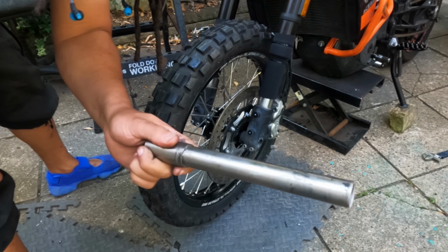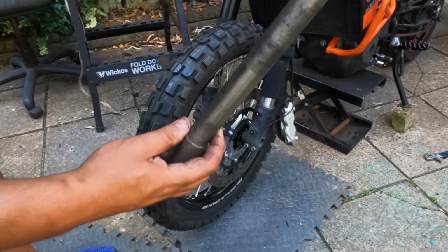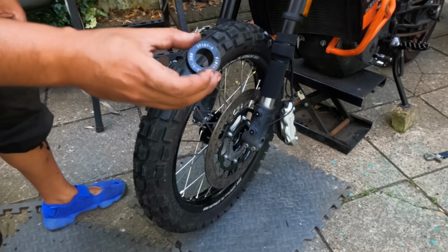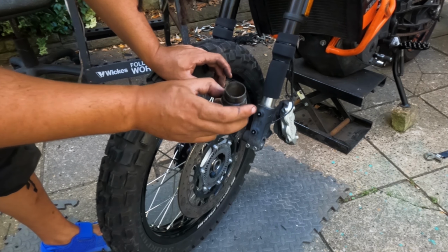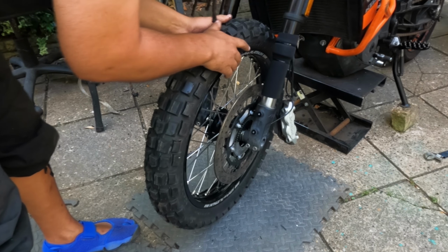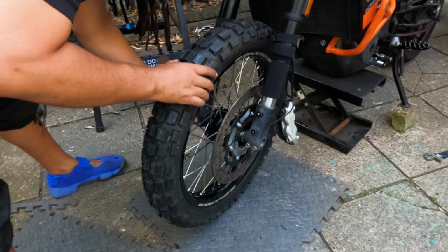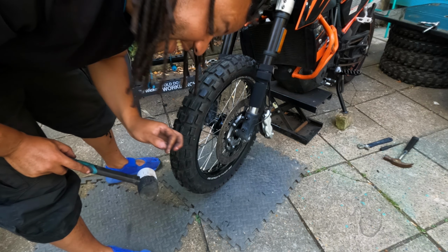Okay, so the Duke axle doesn't fit and the SMCR axle doesn't fit. Turns out it's not the axle that's the problem. The spacers that are the correct size or width have a smaller inner diameter. Wicked. These are the spacers from the SMCR. It looks like it's gonna work. Okay, that's perfect spacing on that side. The wheel is central.